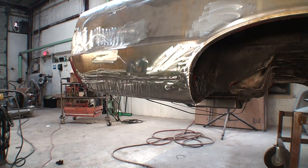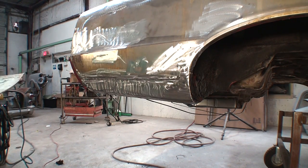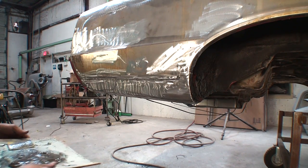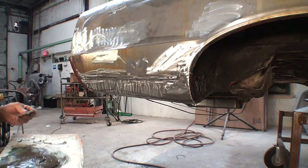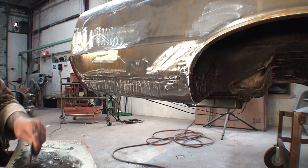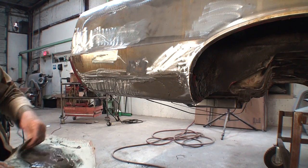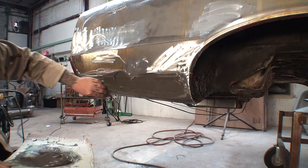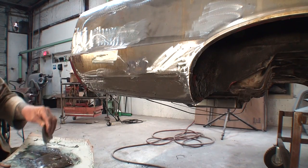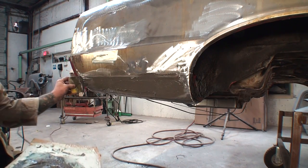What we're going to do today is show you that sometimes when you put your bondo or filler on your vehicle, especially in cold weather, what happens is it sags. I've replaced this bottom section and I have to put dynaglass in to start molding it out. When you add a large amount, I'll take my cheese grater and form it out, but what happens is it starts to sag and fall off when you're doing it on a vertical surface that's not flat.